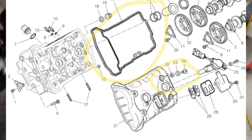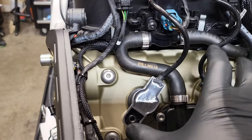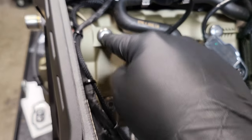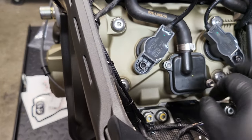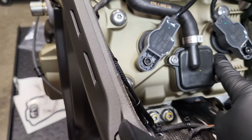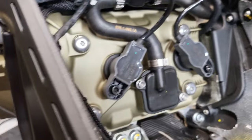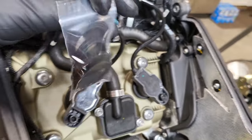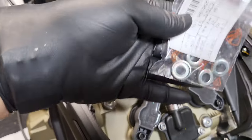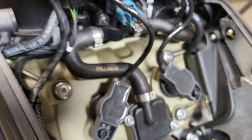Let me show you the back half of the bike and give you a visual of what's going on. This cover here I will remove from the front of the bike — these four bolts are coming out. I have brand new ones, and I have the metal washers that go just beneath this bolt. When you remove these coils here, you're going to have a rubber gasket, and that's where these come in place. I've got the four screws; these go right below the screws, and these guys here are also underneath this cover.